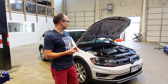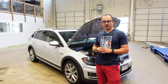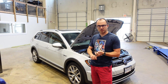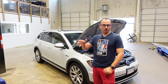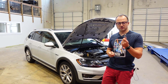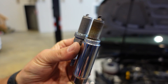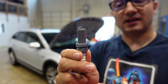Before putting it on the dyno, we're starting to get some misfires at times. Misfires are a common theme in turbocharged four-cylinder engines. When raising boost, we're increasing cylinder pressure, and by increasing cylinder pressure you're going to have the possibility to blow out the spark plug. One of the main reasons you'll get a misfire is that your spark is being blown out before it gets to ignite the mixture, or you have a weak coil pack. Our favorite spark plug for these engines — the 2.0L as well — is the Brisk Silver ER12 racing plugs.